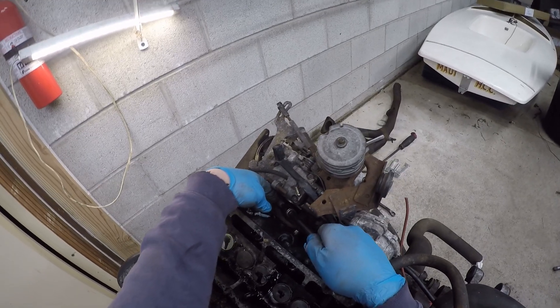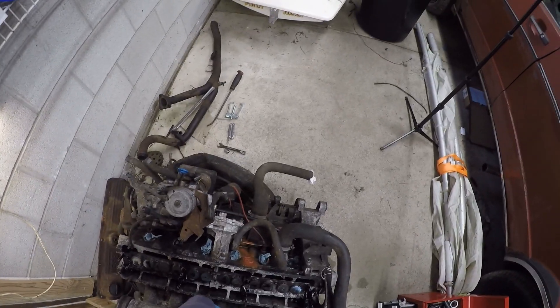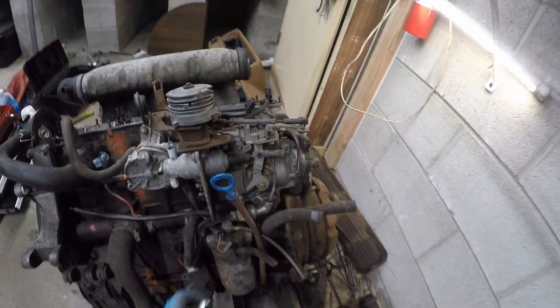There are a lot of benefits to having a diesel engine — you can run it a lot leaner, make a lot more torque, get better fuel mileage. But your big downside is this injection pump: tough to service, very complicated, and extremely expensive to replace.